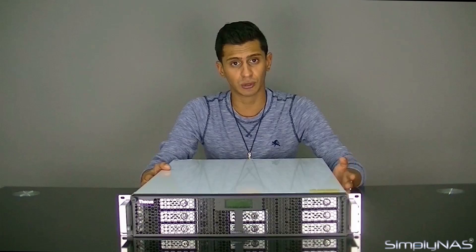The Base-T upgrade means it's a bit more integratable for all of our general networks, as 10GB networks now do use Ethernet ports as opposed to SFP+. That being said, don't get put off by the unit — it is on a PCI slot, so you can switch it out for a dual-port Base-T or you can move to SFP+, if your environment requires that.